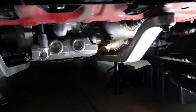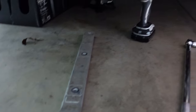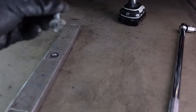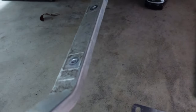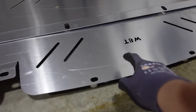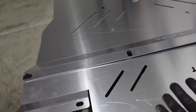Let's go ahead and get these removed — these are just 12-millimeter bolts. Slight change of plan: I ended up removing these two bars. I figured it'd be a lot easier to show you guys how to install this with the two bars off. In the beginning we removed two bolts, and in order to get it completely off, there was another 12-millimeter bolt holding it at the end. Once you remove those two 12-millimeter bolts from each side, you have free access to the bars. I didn't end up putting the front piece on first — instead, I married the front piece into the back piece and I'm going to put it together on the car as a whole.